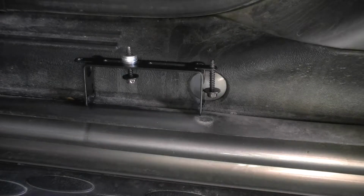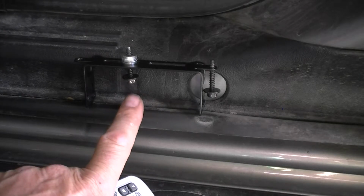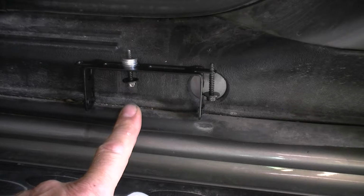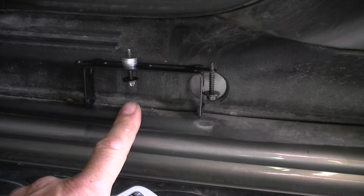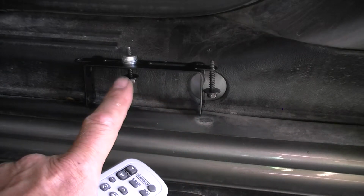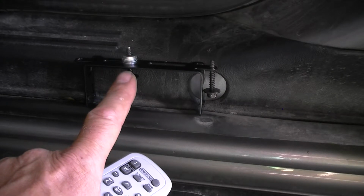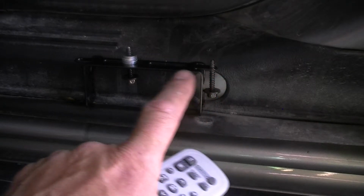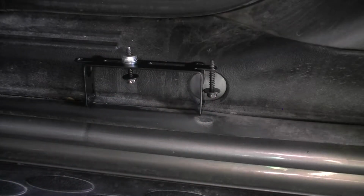Okay, I went ahead and removed the screws from the dash. This screw on the left is actually a little bit recessed behind the panel. I had to use a 7mm open end wrench to get it out. A little finagling, but I got it out without removing the panel. This one came out easily with a 7mm socket. I'm going to use 6 number 8 washers to shim the bracket up level with the tab on the plastic panel. You'll see it all once it goes together. But so far, no drilling of any holes.